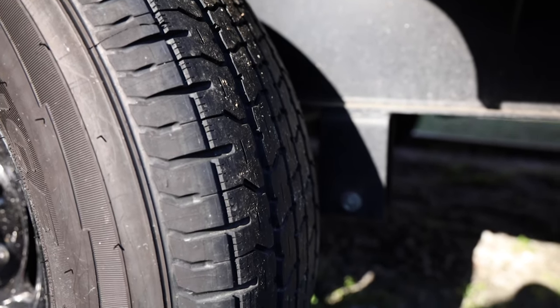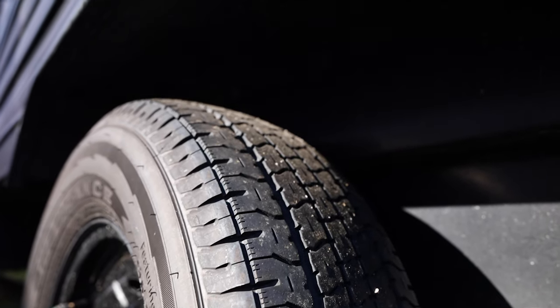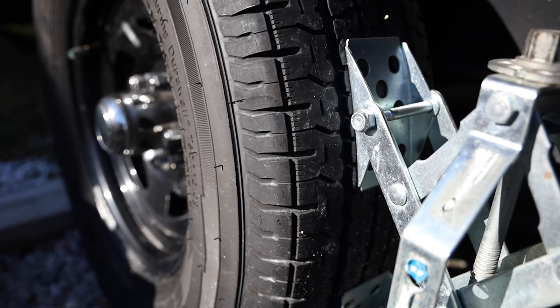The next thing on the list is talking about tires. You need to check your tires really well — things like air pressure, how good the rubber is on the side, checking for cracks, and checking the tread. Make sure there's plenty of tread left. As you go down the road, you want to make sure that you and your RV are going to stay safe. Nothing worse than your tire falling apart and ripping your camper apart. I have a video about that as well, linked in the description. If you find issues with your tires, this is a good time to have them changed out so that you have a successful trip.